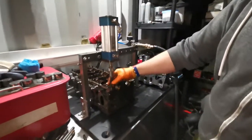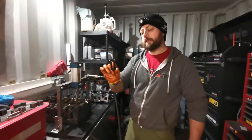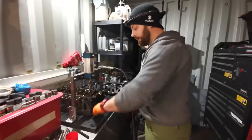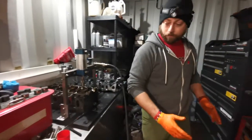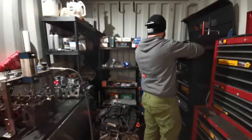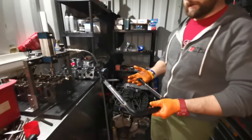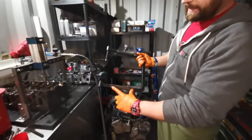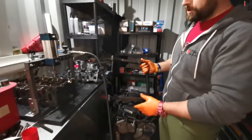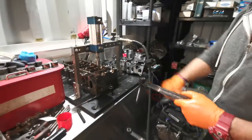It's quite easy to make from leftover scraps. All you really need is the normal pushing device. Our old system was a cheap and nasty off-Amazon valve spring compressor. What we've done for the VR heads is extend it by about four inches because the VR heads are so huge — a standard length valve spring compressor of this type won't be able to get in.